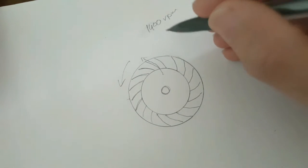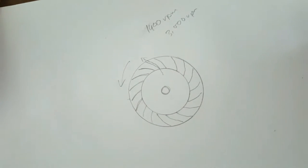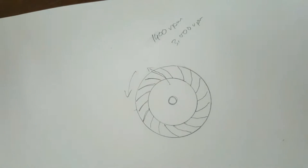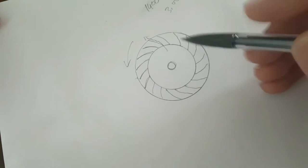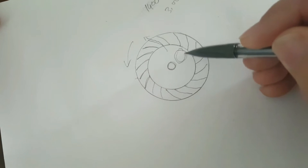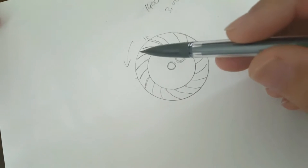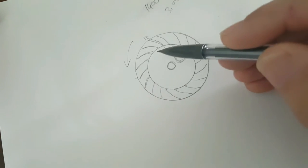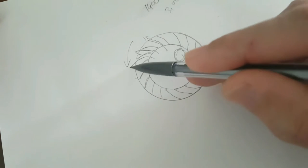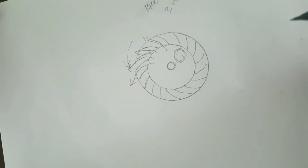Your air conditioner blower spins at around 3,000 RPM to blow air for the air conditioning system, and that's a much wider blower compared to your brake disc. So the rotor alone does not produce significant airflow. What brake ducts do is add a duct here that goes all the way to the front of the car, forcing high-speed air into this gap. All that air is then forced out from the disc, which is a lot of airflow and makes a significant difference in cooling.